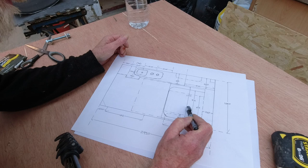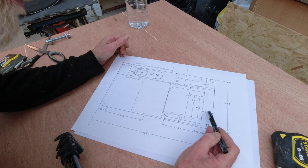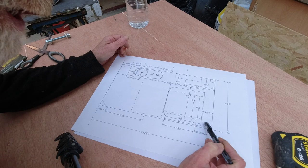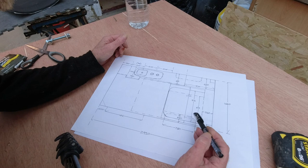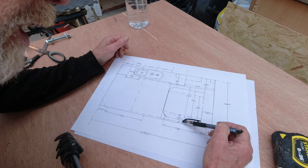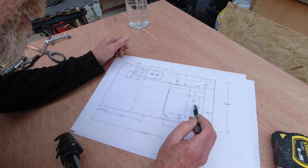The first consideration was the rock and roll bed - I've decided it's going to be 260 from the back door. The reason is I want the cushion to curl around this pillar, and with a cushion on there it will be level with the pillar. A little cut-out in the wood means when the back section of the bed folds up it should be flush with the back door. When extended, the bed will be 115 centimeters wide and over 190 centimeters long - more than six feet. That clears the wheel arches.